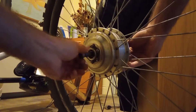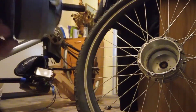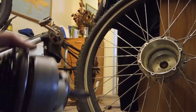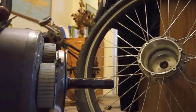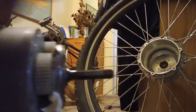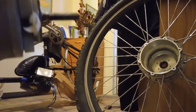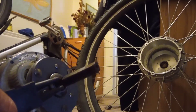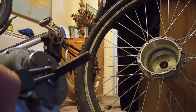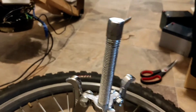So the plan is to weld the clutch together, but that involves a lot of electricity. The motor just slides straight out — as you can see it's in perfect condition, but it has a lot of expensive, delicate electronics in there, and I don't want massive surges of electric energy running through it. So instead I'm going to remove this and work on it independently so it can't damage any of the electronics. The first step is to remove this little pin here. Once you remove the motor, you're going to want to put one of these puller tools on — these don't cost much on eBay. Then you've basically got to undo it and lift it out.